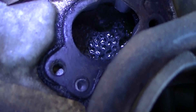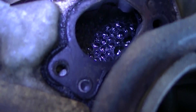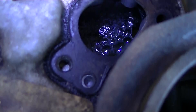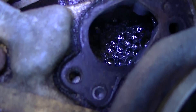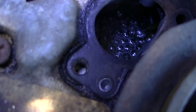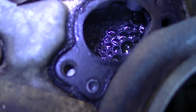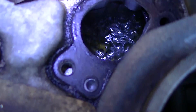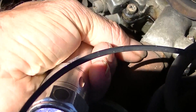This is the new gas we have in California. It's got a ton of isobutane in it. I actually noticed this first in my generator vapor locking, and then this car was vapor locking — and this is not that hot. I mean, I can hold my hand right on the float bowl.